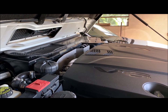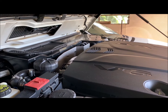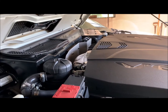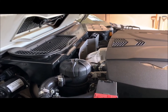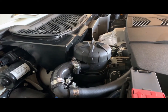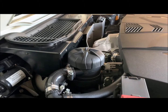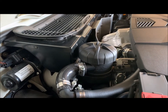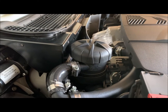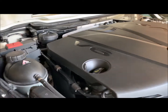Engine manufacturers will not do that anymore, so now all of this is going into your inlet system. One way to remove those blow-by gases is by fitting an oil separator, sometimes also referred to as a catch can. The unit I've fitted to this vehicle — this Mercedes specifically, on the OM 642 engine — is the Mann+Hummel ProVent 200. I'll show a bit more about this, but in the meantime I'm going to show you what I did and how I managed to get this installed. Let me take the engine cover off.